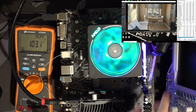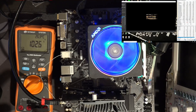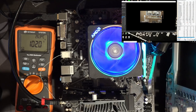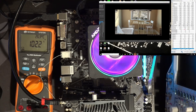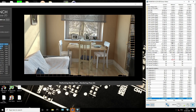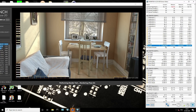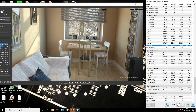Anyway, I'm just gonna bump up the fan speed setting on the cooler, and I'm gonna show you what that does to the VRM temperature. So now the fan is doing over 3,500 RPM. The VRM temperature should start dropping and get down to somewhere around 90 degrees eventually. So it is very loud, but the VRM temperatures should improve slowly.